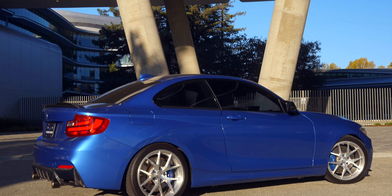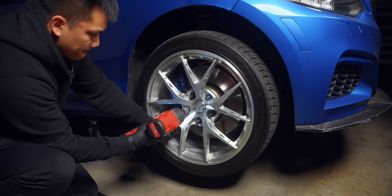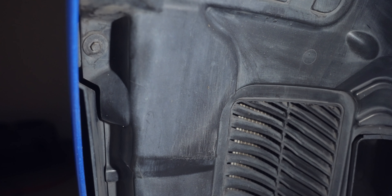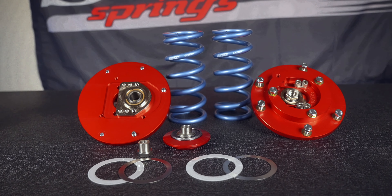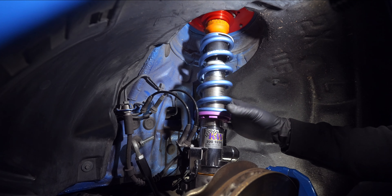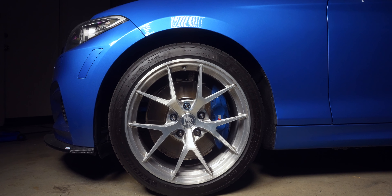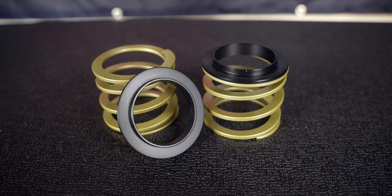This is my new wheel and tire configuration that unfortunately isn't getting along with my coilover setup that cost almost $5,000, even at its max ride height. So I swapped it out for some stiffer lowering springs and a new set of camber plates, resulting in this major wheel gap. This is because the lowering spring needed to be all the way up in order to have any preload, and although this would fix the rubbing issue, this gap is a bit excessive — which brings us to helper springs.